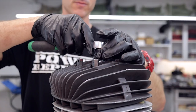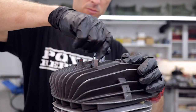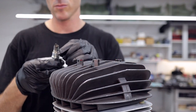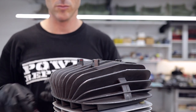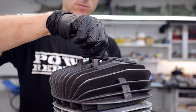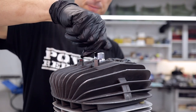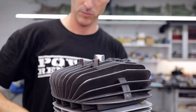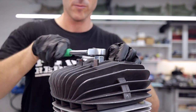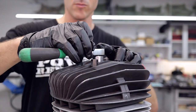A nice thing to do before the race season is to put in a new spark plug. Remove the old spark plug — we're not going to throw it away, just put it in the toolbox as a spare in case you need one at the track. Put the new one into the engine and tighten it down using a three-eighth drive socket. Because it's brand new you need to squash the washer down — nip it up, back it off a little bit, then do it up nice and firm.